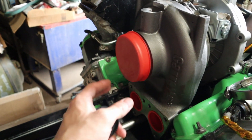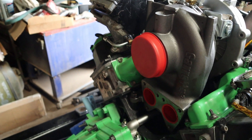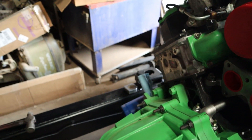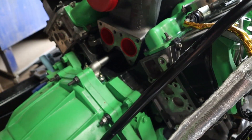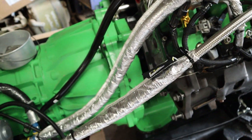I'm going to leave this exhaust downpipe plugged up for now until I can get to modifying it. On this installation, we're going to have the downpipe go on the driver's side over there instead of the passenger's side as it did on the original vehicle. I will go ahead and mount up the uppipes on here, so let's get to that.